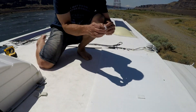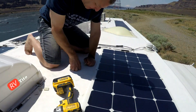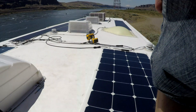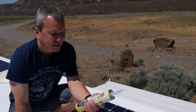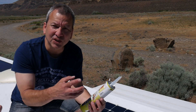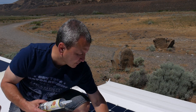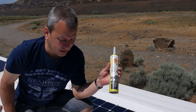I'm going to repeat the whole process on the other panel, get that mounted, and then when I'm all done I'll seal everything up with some Dicor. Panels are all on there and they seem pretty secure. The final step is to seal everything up with Dicor — not just over the screw holes but all the way around the panel, since those holes are where there's actually penetration through the roof.